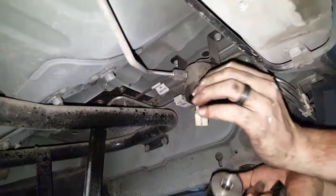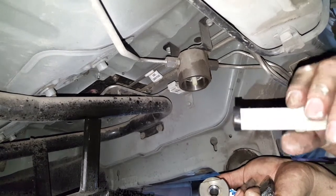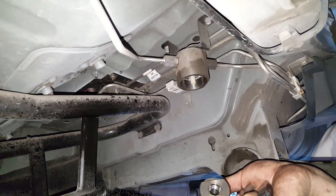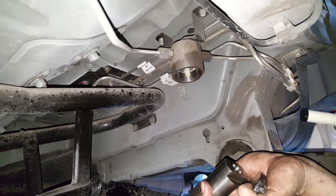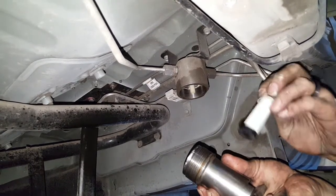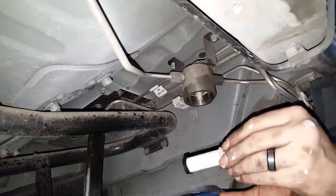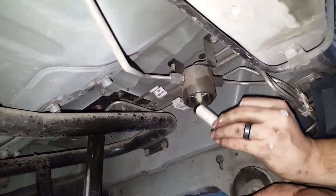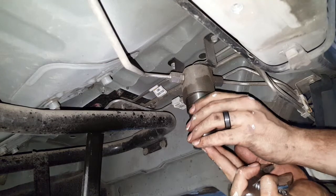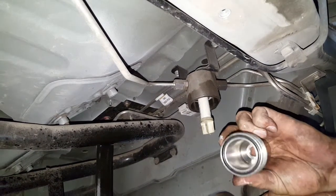So now we've got this little guy here — be careful, it's very weighty — and it actually looks to be in pretty good condition, considering all that oil that was just accumulated at the bottom, which is why I've done this. If this whole thing fills up with oil, it will dip and soak the fuel filter. If yours was all dirty and oily you'd want to get a new one and pop it right back on — it's as simple as that. But I'm going to clean this guy out a little bit before I put it back on; I recommend you do too. You should also check and make sure your o-rings are still sufficient — if not, replace them every time you do this.